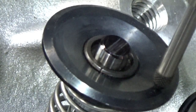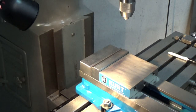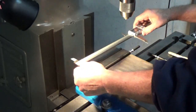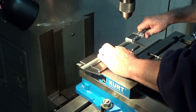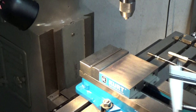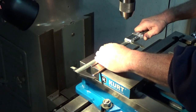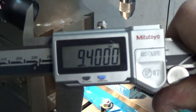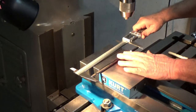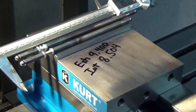This is how I go about getting my pushrod length. I'll call the manufacturer, and a friend showed me how to lay the pushrod on a vise with calipers to measure it perfectly — it's a wonderful technique, works so well. Now I have the pushrod length I'm pretty sure I'll go with. I'll call the manufacturers and find what pushrod lengths they offer closest to those numbers.